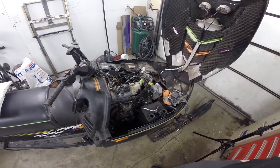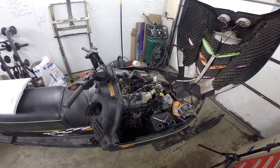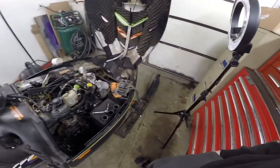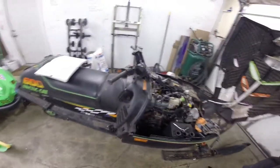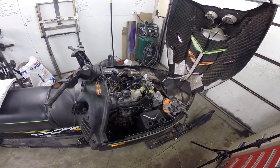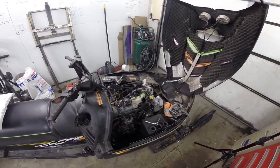Due to my ever present shit show around here, this is the first time I'm getting to it. It's been almost a year since I've touched it or heard it run, but finally getting back to it. I did get another ZRT, a 2000, that I sold some parts off of. I still got coils, CDI unit, actually got the complete motor, stator, all that stuff. Just worried maybe I had a stator issue, but did all the testing by the book — checked everything out, getting good numbers, but still no spark.